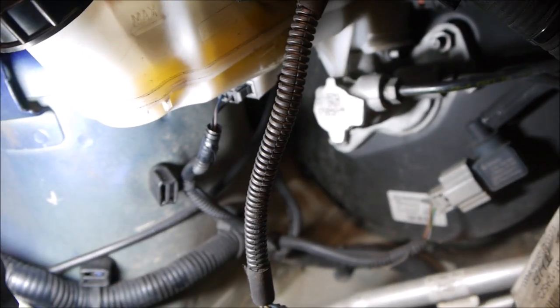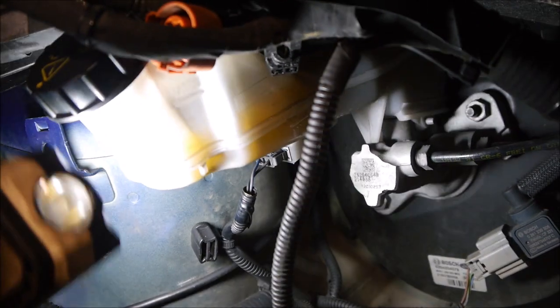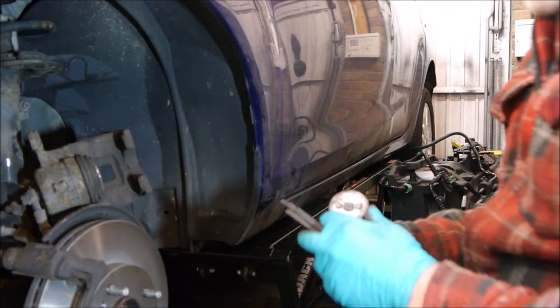The level is just below the Ford logo — just below this seam, which is minimum — and maximum is up here. So you can see we're a good half inch below maximum. We need to wind this piston back in, and what I'm going to do is just put the old pad in there and use the tool to wind the piston back.